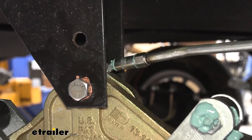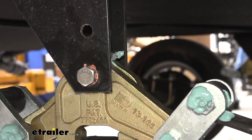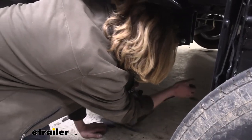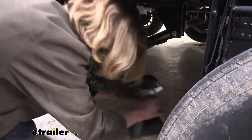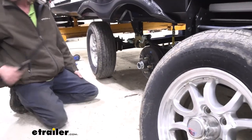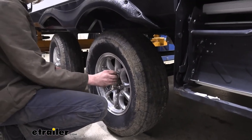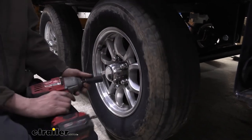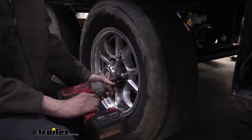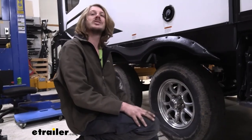Don't forget your equalizer fittings in the middle — they don't take much, just a pump and a half was enough to grease them. There's also one on the other side. Now we've got all our hardware torqued down and everything's greased up. Make sure you get your jacks out from underneath. Go ahead and reinstall the wheels — always best to tighten them down in a star pattern. Then perform the same installation on the other side, and once it's all back on the ground, torque all your wheels to the manufacturer's specifications. That completes our installation of Dexter's EZ-Flex on our 2021 Grand Design Imagine.